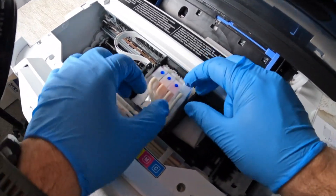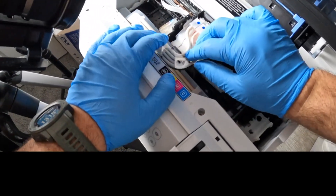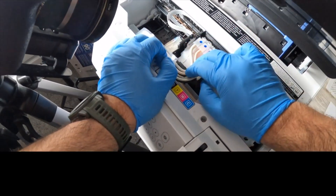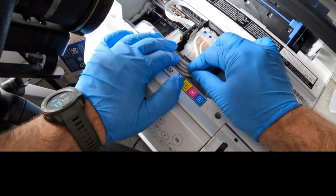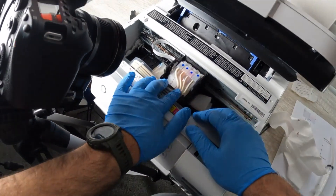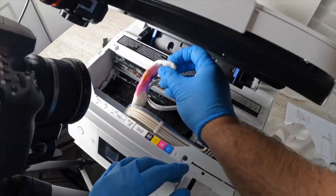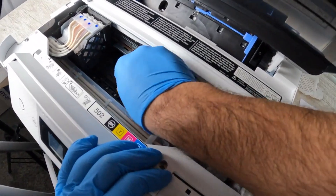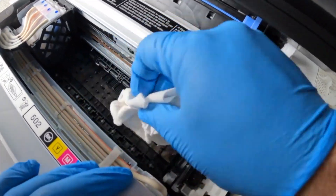Once things start to clear up on the paper towel, that's a great sign you're done. When finished, make sure everything is completely dry before powering the machine back on — if it's not dry, you could damage the printer. Dry around the ink nozzles and under the print head; move the carriage back and forth to check. I'd even recommend leaving it for 12 hours so any solution in hard-to-reach areas can fully dry before powering on.